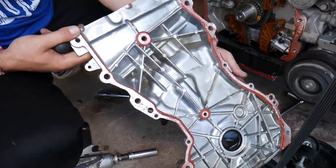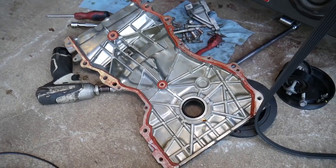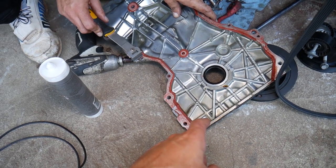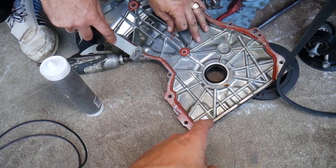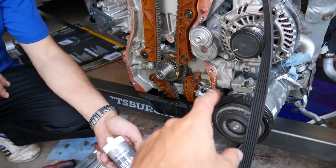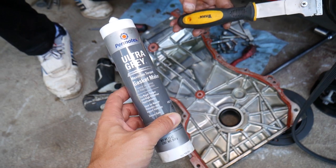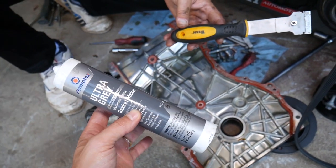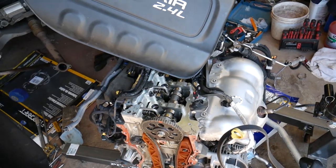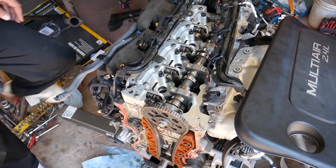This is all the silicone you'll need to remove. When you're ready to reseal, use a scraper to clean it really well, then clean with brake cleaner. Make sure nothing falls into the open engine. We use ultra gray maximum torque silicone - we like it even better than the red one and we've used it for so long without any problems. After you remove the timing cover we continue with the next step.